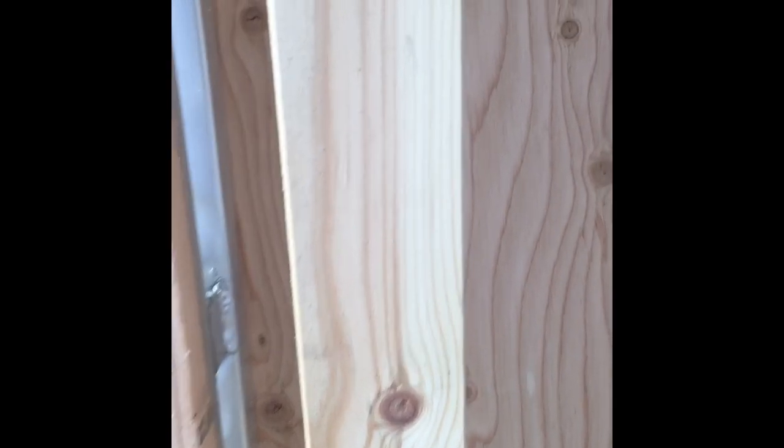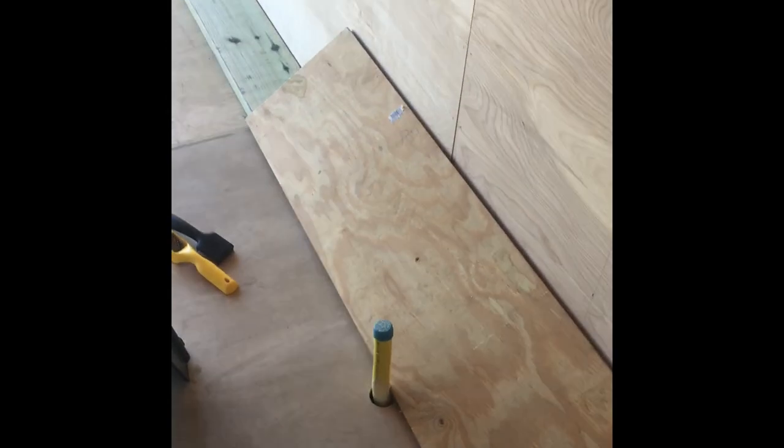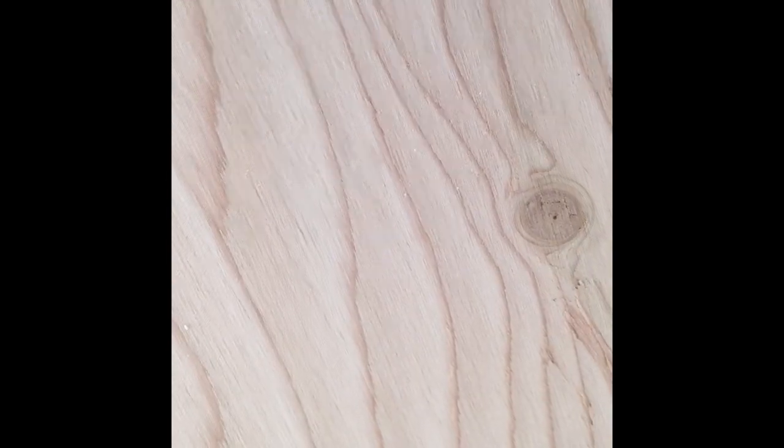This is my blackwater vent pipe. It's going to come straight up that wall and go right through the top plate, then right out through the ceiling. I'm not going to drill through the ceiling right now — I'll do that when I put the vent pipe in for sure. But at a minimum I want to get my hole here, because the ceiling isn't getting spray-foamed until all the electrical is done. When I'm ready to put that vent pipe in, I'll just drill through, put the pipe up, put the cap on it, and seal it off. If I don't do this now it might be more difficult in the future.